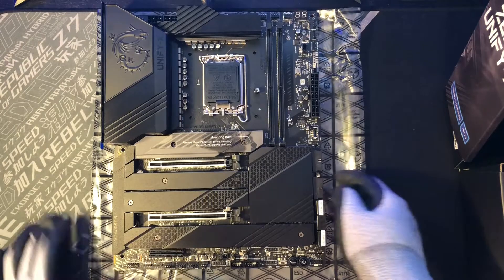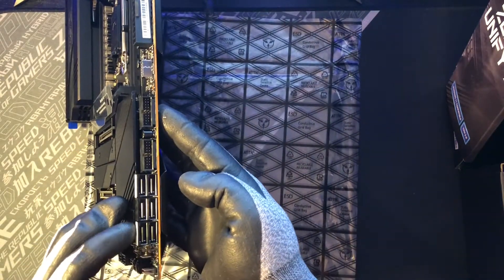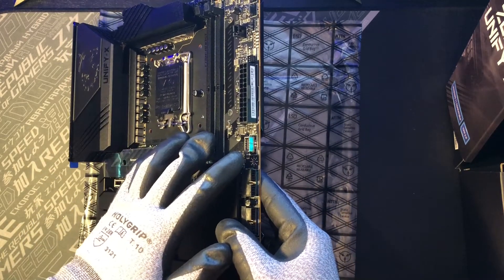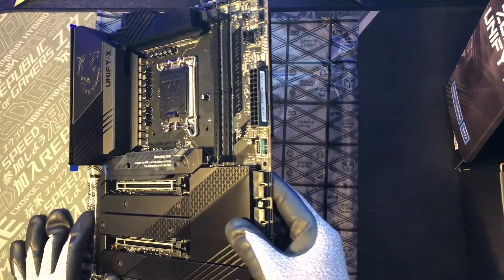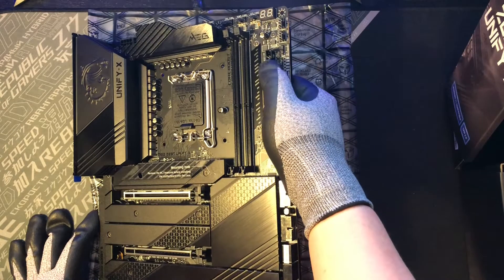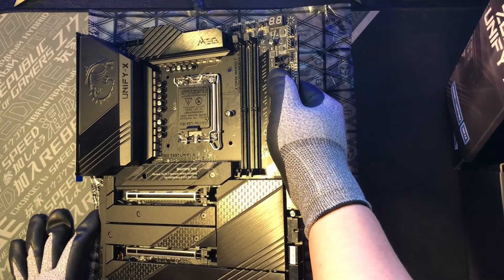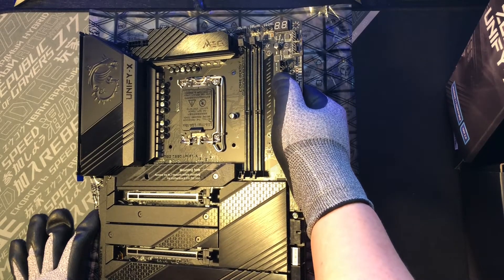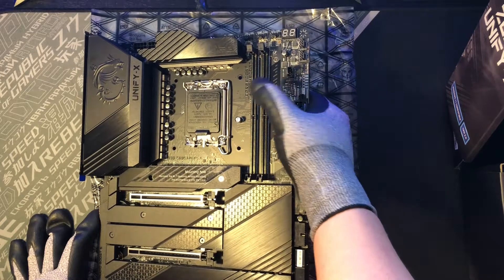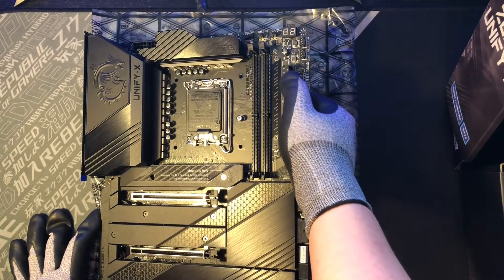There's USB 3.0, there are two USB ports here, there are six SATA ports, and this is the 24-pin, and this is for the USB-C port on your case. There are some fan connectors and some RGB connectors here. And this one is designed specifically for Corsair — if you're using a Corsair ecosystem with MSI, it connects here so that MSI Center is able to control the Corsair lighting and everything through this Corsair port.